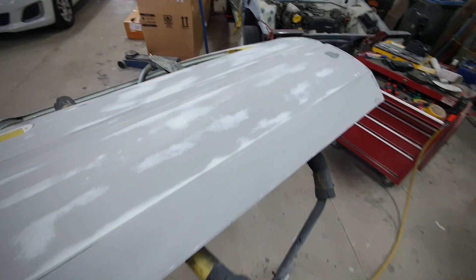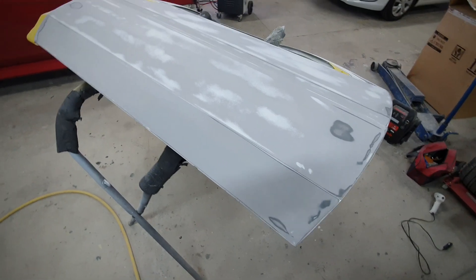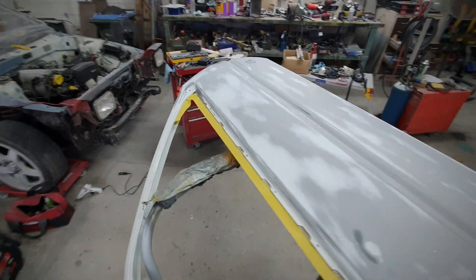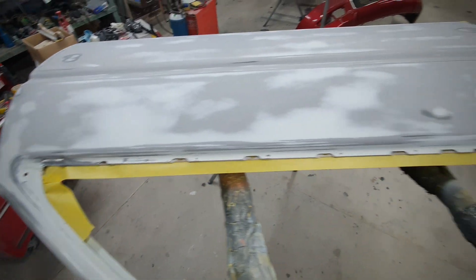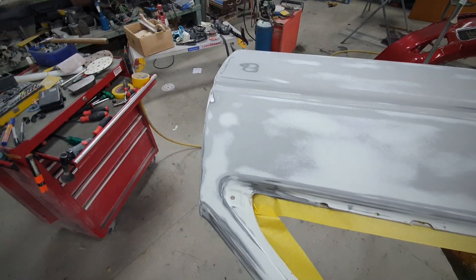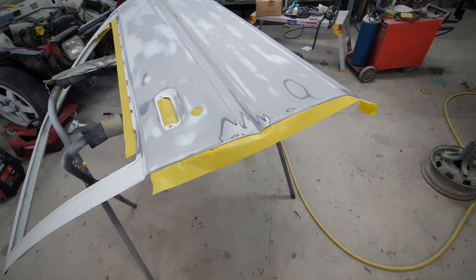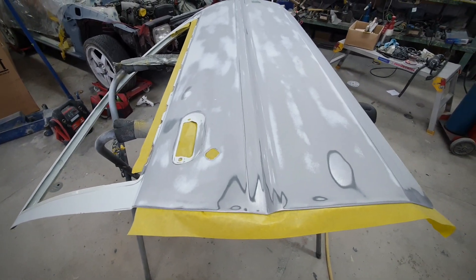Just finished blocking back this main panel of my door. I haven't stripped it back to bare steel yet — I'll do that when I do the final proper primer. Not one bit of bog found on this, which is wicked. And there's a funny little paint blend that sort of ended in here — it's really weird because it only went to there and then there's nothing, just straight through factory paint. I'm pretty stoked about that. And just gone through the edges here, taking off the little bits of rust underneath the paint — sort of spiderweb rust which is creeping underneath. Same with down that edge. So I'm just going to spray a bit of grey over the metal bits and then that'll be it for tonight.